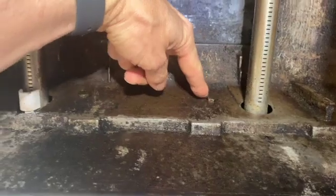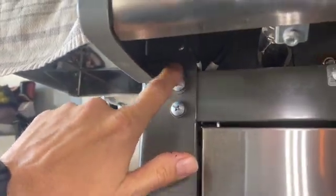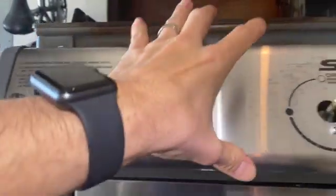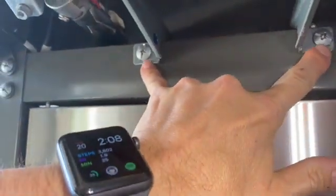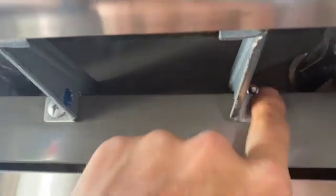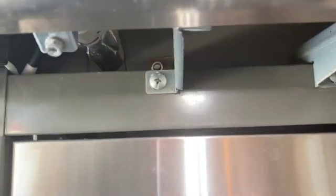The way we're going to get at this is I'm going to lean down. You've got a bolt head here, bolt head here. That's the 11mm. Then we're going to come underneath here and remove this screw that's holding up the control panel, and this one over here. These two that I mentioned, and then this whole thing will lift straight up, maybe an inch, half an inch, and come up and off. And then from there, you'll go at these two larger screws, and then directly above it, inside there, is the other end of the nut for the 11mm. Once you remove those, everything comes out.